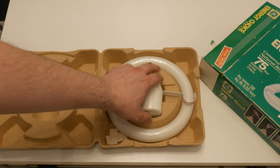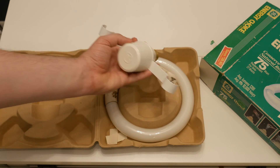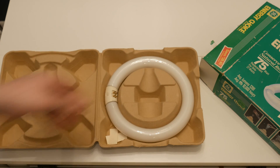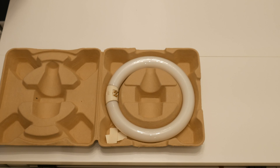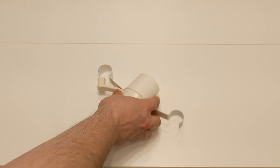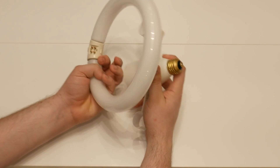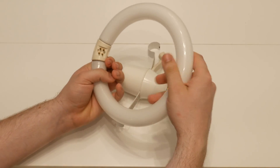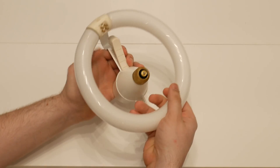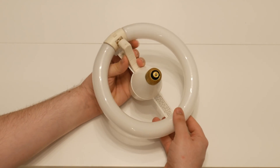So what is this? Well, it's a not-so-compact fluorescent lamp, or an NSCFL if you will. It looks as though GE may have been making these things since the 60s in various forms. This is a magnetic ballast and starter plug concealed in — and I hesitate to call it such — an attractive adapter. You can tell it's a plain old magnetic ballast because it's one, old, and two, surprisingly heavy. It drives a 22 watt T9 Circline tube and is meant as an energy saving alternative to incandescent lamps.